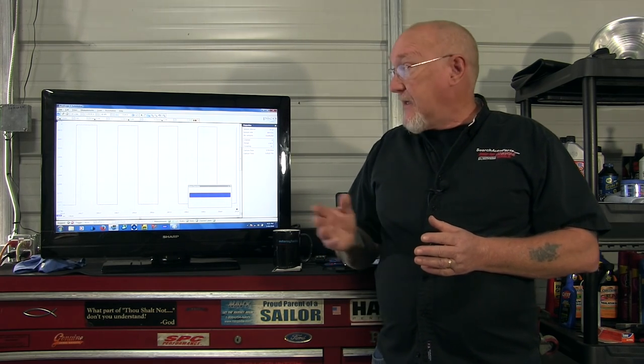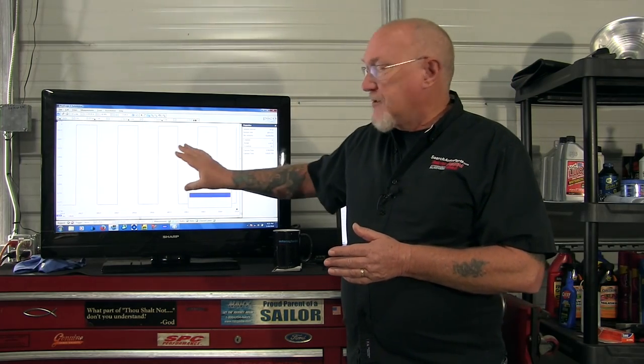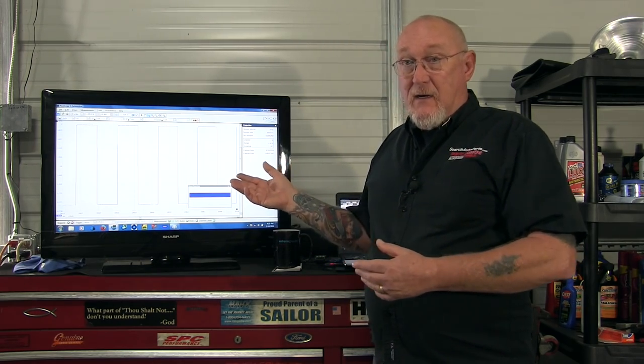So what does this mean? Consider the signal you're trying to capture and how you're capturing it. I could have used the first sample selection with no problem if I had reduced my time base so that the signal fit on a single screen — because then the effective sample rate would have been much higher. If you want to capture a long time base, you have to crank up the sample rate to get an accurate representation of a fast signal. But there's a limit: on my model the buffer holds about 250 million samples, so these are all factors that come into play with advanced scope use.